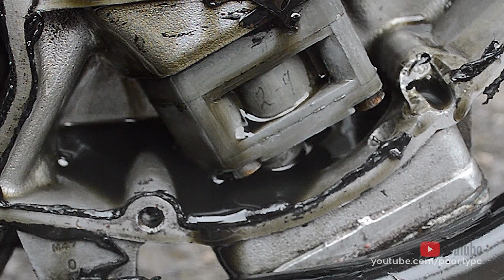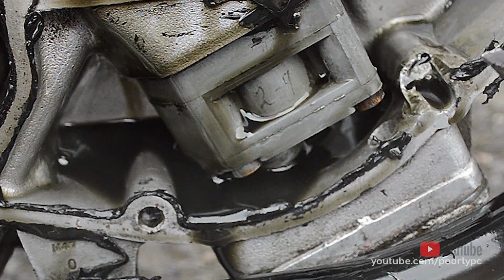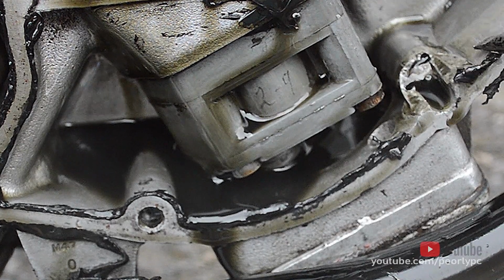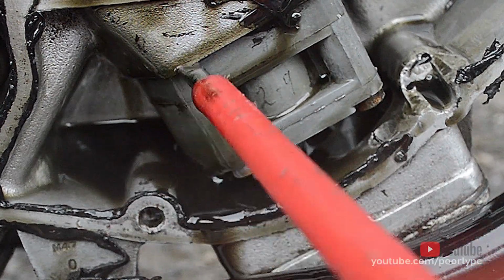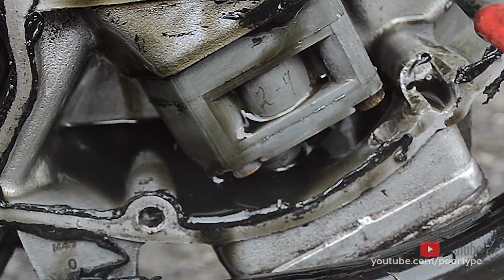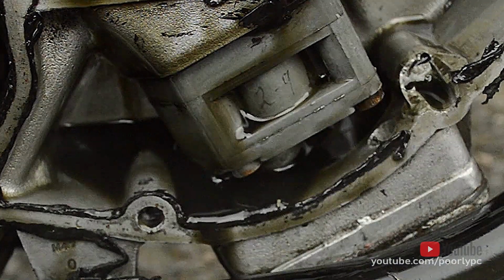So clearly what you can see there is why I'm getting oil pushed out of this broken casing screw. In fact, look, sorry I covered the camera up on that angle, but there's a broken case screw here that needs building up. Rob, I reckon once that's cleaned up, mate, you can get to it. But look, there's the sump, there is obviously the oil pump, and you can clearly see why oil is being pumped out of this open exposed aperture at the moment.